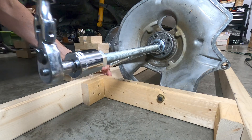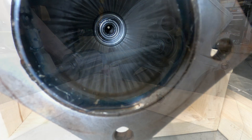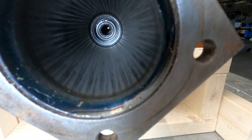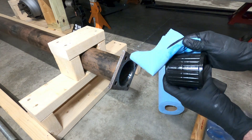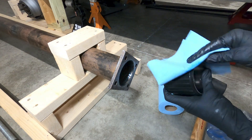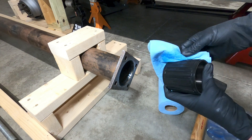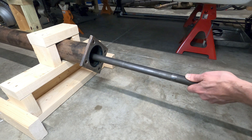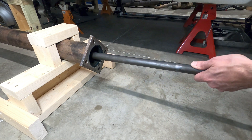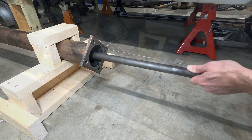This procedure should be used for all three super bearings aft of the shifter holes towards the transaxle end. Step 7: When placing the front super bearing into the engine end of the torque tube, no additional lubricant outside the WD-40 wipe-down on the outer body should be applied to it or the front of the tube. This is so the front super bearing won't move when initially placing the driveshaft through it, when angulation of the driveshaft is most problematic. Once a driveshaft has passed through the second super bearing, the shaft can be depressed with little concern of further angulation, which can drag the super bearings from their positions.